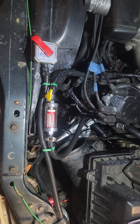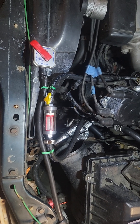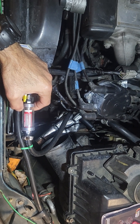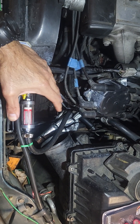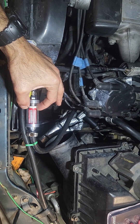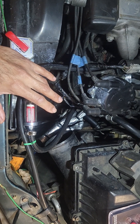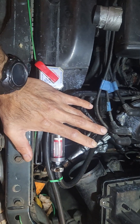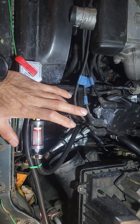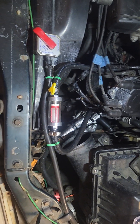This is a video on how to add a coolant filter on a budget by using an inline fuel filter. Very importantly, you're gonna want to use a glass or metal fuel filter. If you use a plastic inline fuel filter, which are used on carburetor vehicles, that's gonna bulge and it can easily pop off or explode.